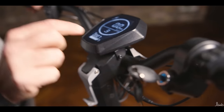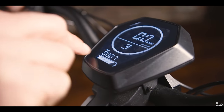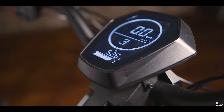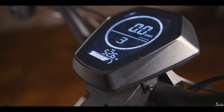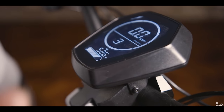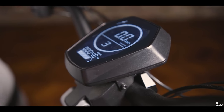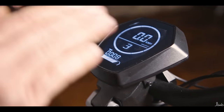When I go to the mode button, you can see the battery gauge at the bottom. There's a ride time display — you can flick through to see the trip distance, the odometer showing total kilometres, and the voltage reading, which is often more accurate than the battery percentage. At 52.6 volts we're about three-quarters battery — it goes all the way up to around 58 volts on a full charge. There's also an estimated range display showing how many kilometres you've got left, currently showing 48 kilometres — very useful so you don't get caught short.